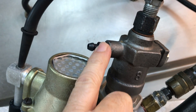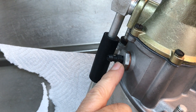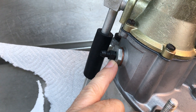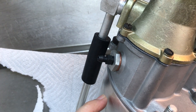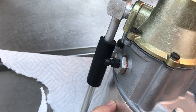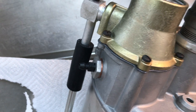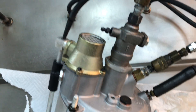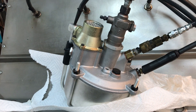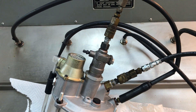This bleed screw does not need to be messed with when you're bleeding the brakes. Bleed the brakes first here, then do your lap around the car: left rear, right rear, right front, left front — and then bleed the booster last. Sometimes you need to make two laps around the car, but we got you a good booster and I sure appreciate your patience. Thank you very much.